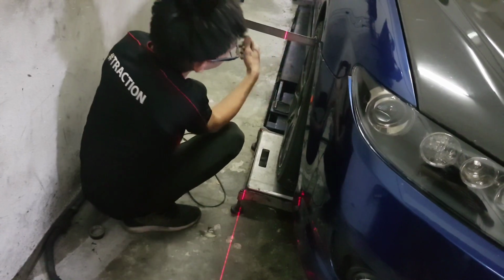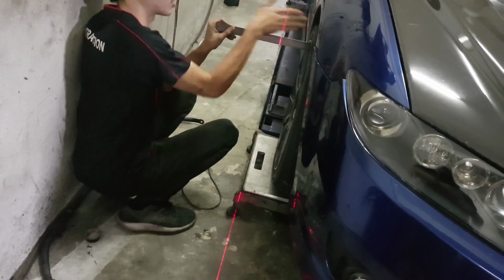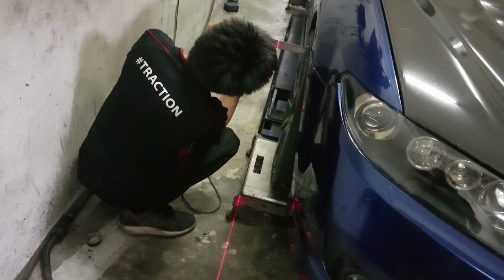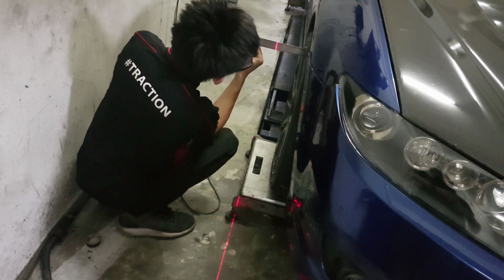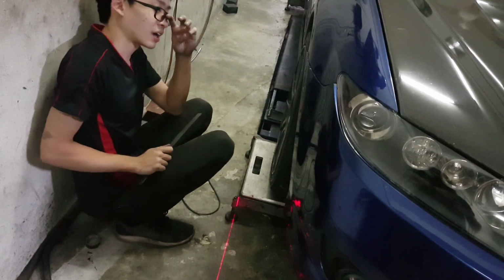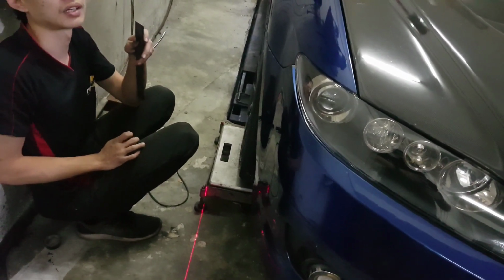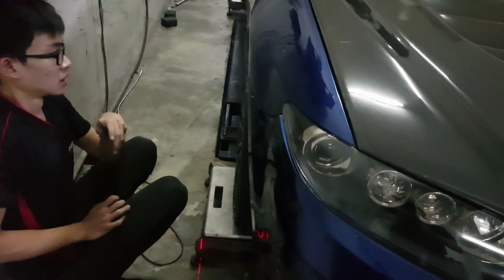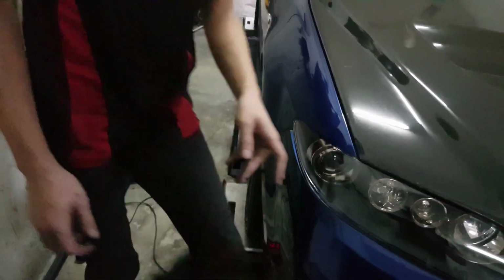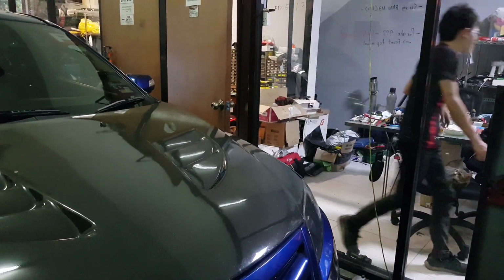Okay. Then check the reading at the top. Make sure the ruler is entirely straight. Any difference in measurement? Yeah, here I am reading 12 cm, so 120 millimeters. From there, we put it into calculation and we get the resulting camber. How many degrees for that 20 mm or 2 cm difference? I probably have to calculate it because it changes based on the rim size as well. Yeah, you have to take rim size into consideration while calculating your camber.